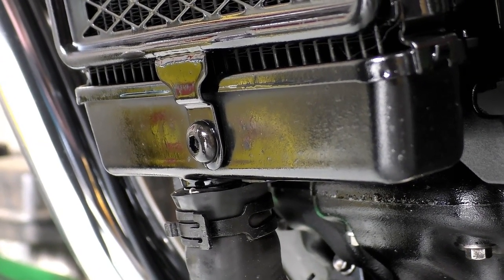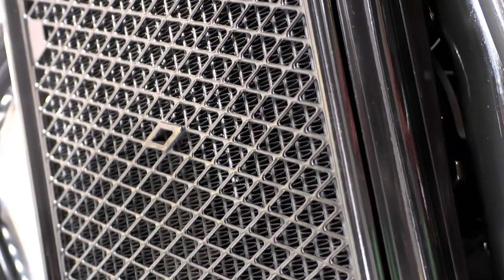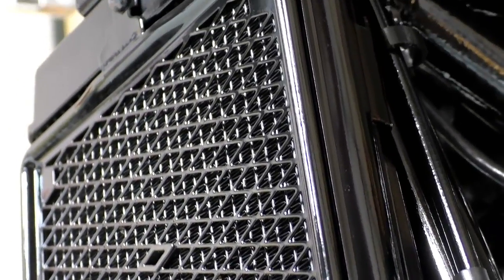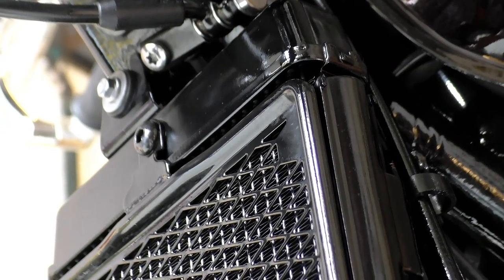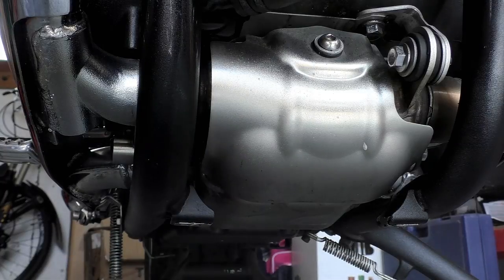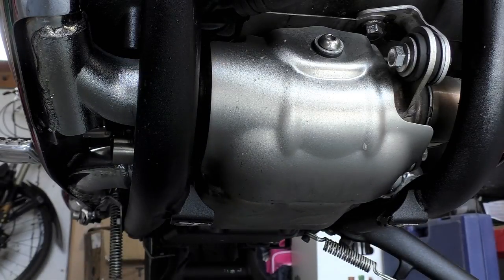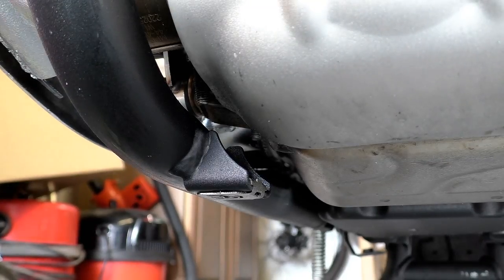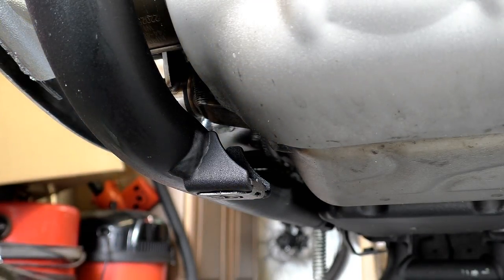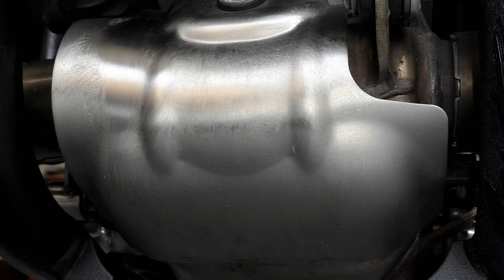Treat all your engine, your radiator, and the upper parts of your frame with Double TT. Also soak a cloth or workshop wipe with it and smear it over your front fork legs. When you've done that, go around and gently wipe off any excess or runs. What you should now have is a bike that is about as winter-proof and corrosion-protected as you can possibly get. Inspect your bike regularly and make sure both protective chemicals are intact. Reapply the Double TT regularly, especially after a wash. With the Wax Oil, check for any scrapes or areas where it may have been rubbed off and reapply. Once the Wax Oil has been on for a few years it may start to dry out and crack — if it does, clean it all off with white spirit and reapply.